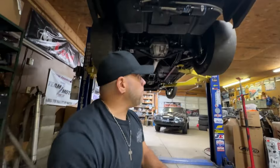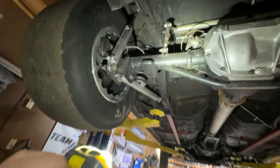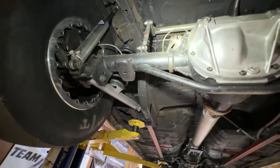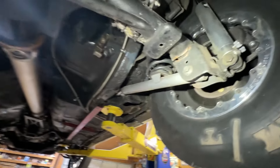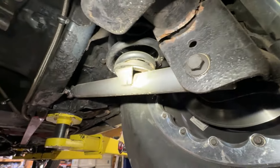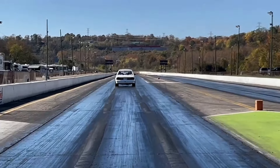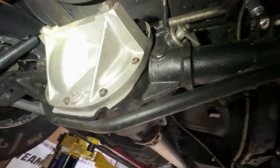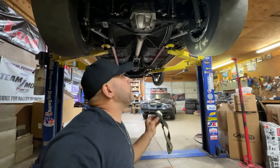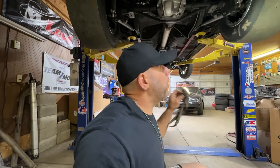Here's what we found. I was getting ready to finish up my checks - I wasn't even going to come back here and look because I had already looked before we went to plates and 28s. But I'm really glad that I did, because I was looking over at my axle. I always check my strut, my links, and my anti-roll bar, and I just happened to look over here and this is what I found. This is crazy - I don't think I've ever seen this. I don't know when this broke or cracked, but this is your lower control arm perch. This thing comes detached from the 8.8 axle - this thing's going to go right into a wall. I've heard of cars steering right into the wall, and this is just the importance of the safety check every time.